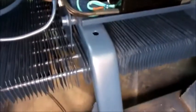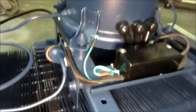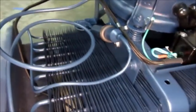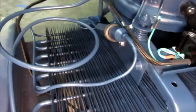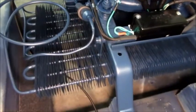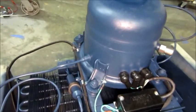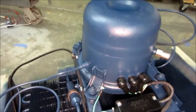2.15 amps, 145 watts — sounds very nice. I know that blue is a little bit brighter than the original Kelvinator blue-gray, but I like it — it really looks good on there and conceals the fact that the tubing is different types of material. The repairs I made always use copper tubing because it's easy to work with; the factory used steel, and now you can't tell these aren't original lines. Well, alright folks, that's it for today's short video. Now it's going to get rolled in the corner and covered up until the cabinet is done, and then we'll see it all go back together. Thanks for watching.